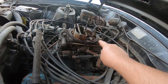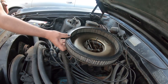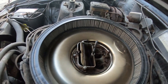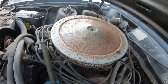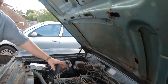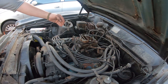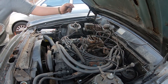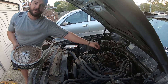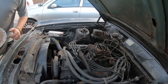Just cranking it and it was pissing out of the rear needle and seat. A good sign to me was it actually had a base and lid so it was sealed. The base is in pretty good nick. It had a lid sealed and there's no holes in the bonnet — well, there are some holes way up the front, but. Cars like these are tricky — flakes from the bonnet can fall straight into the carby as soon as the lid's off. It's a bit of a pain to pull them off the throttle blades, but I got the big chunks out.